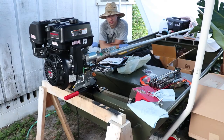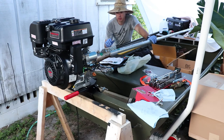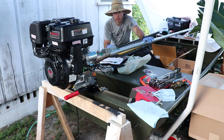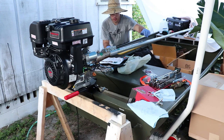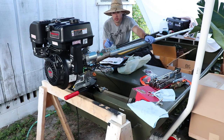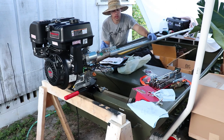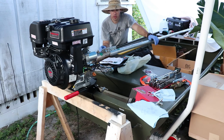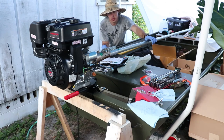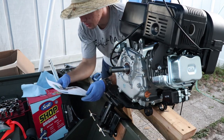We have the mud skipper kit on its mount and on the transom now. We need to get this tail off — this is the beaver dam mud runner kit tail. I put a sawhorse under the motor because when I go to take this tail off, the motor is going to want to drop. So I went ahead and put a sawhorse under there to stop that from happening. Now I'm going to take off this tail and then we can get back to the regular assembly.